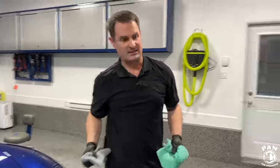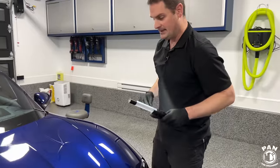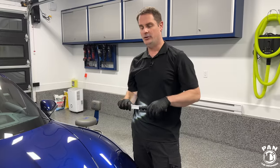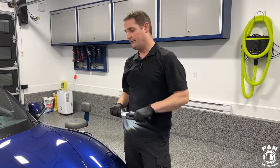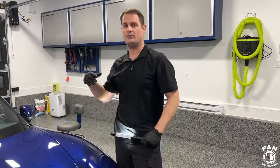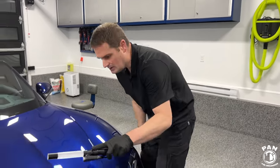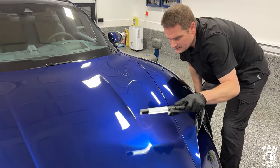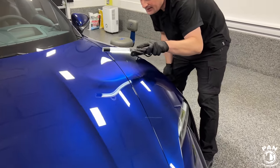Take the inspection light and flash it on the surface. For a full car, I typically use one microfiber applicator and flip it halfway through. If using smaller micro-suede applicators, change them two or three times during the job. For towels, use three to four for the initial wipe and three to four for the second towel, always turning to fresh clean sides. Inspect for high spots. These were flat panels; next we'll move on to what it looks like on a vertical panel like the door.